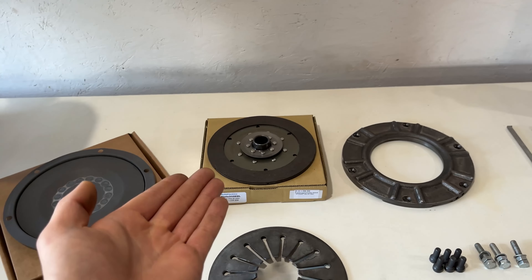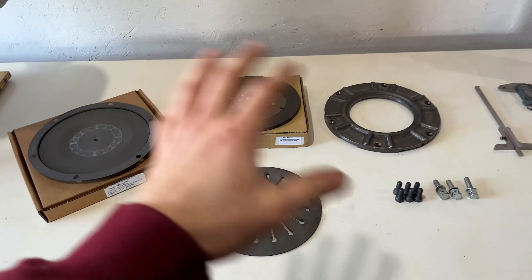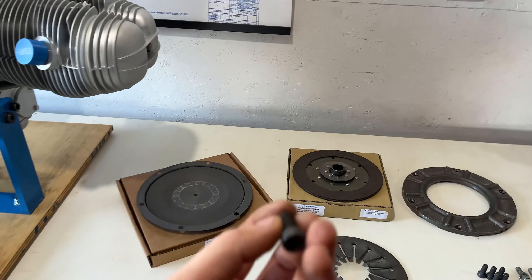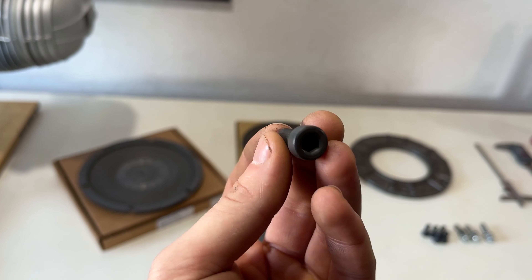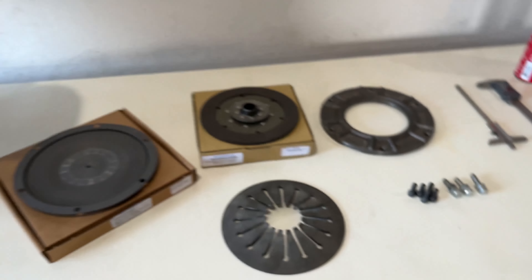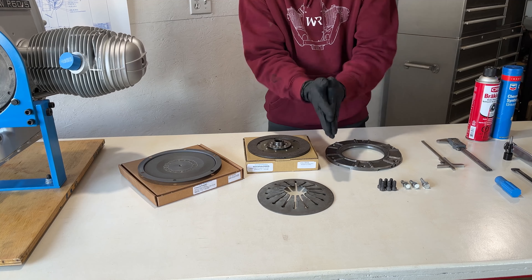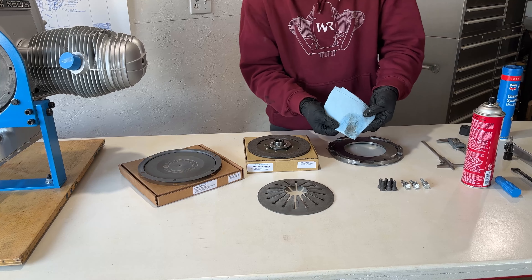This right here is the cover plate and it's just as worn if not worse than the pressure plate. So this whole assembly will be replaced with an upgraded assembly that you can pick up at EME — I'll have a link down below in the description. This kit consists of four brand new parts: on the far left a brand new pressure plate, in the middle a brand new clutch plate, on the far right the cover plate, and down below the spring diaphragm. All parts come in the kit along with six brand new bolts. Some early models had flat heads, so you may want to replace those with these Allen head bolts, which are countersunk as they'll be positioned within the cover plate.